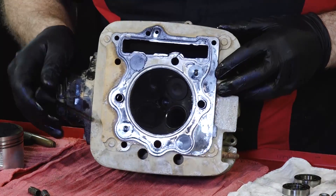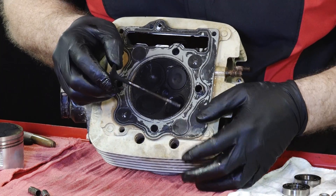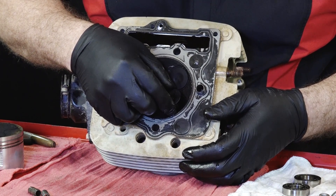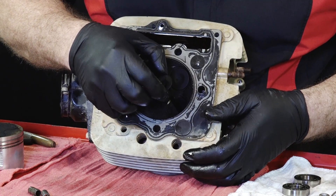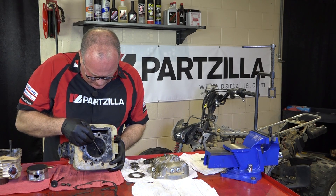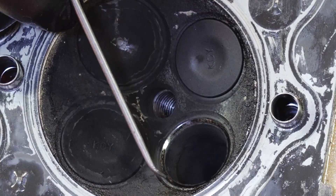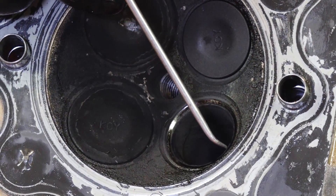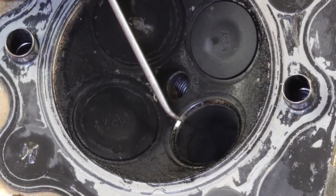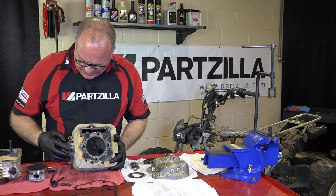What we're looking for here is any wear on the valve itself. That actually looks good. Put the valve in and make sure it isn't rocking around too much — just wiggling it back and forth. All that feels good. You're also looking at this section right here which represents where that valve is actually seating or sealing up into that seat. I don't see any points where it's not sealing up pretty well, so that valve really looks to be in pretty good shape. We're going to go ahead and pull all four of them and take a look at the other seats and valves as well.